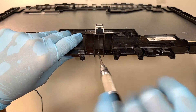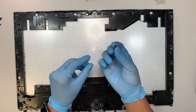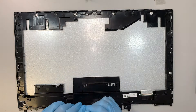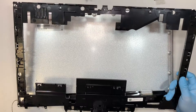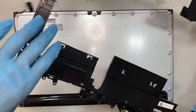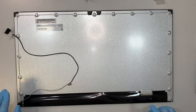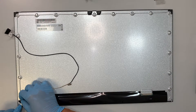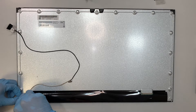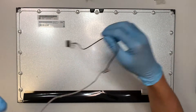There are 10 screws in total — there's one little one right in the center. That center screw is a little bit different compared to the rest, so make sure you know that this skinny tiny one goes in the center of that plastic. Make sure you do not break the cable at the bottom left — that cable goes through the plastic, so save the plastic because we need to reuse it later. Now disconnect this little cable at the bottom left by pressing the little clipper and pushing it away from you, then pull to remove the cable. Save it on the side.